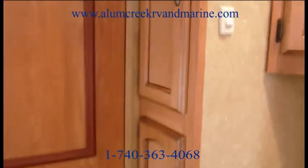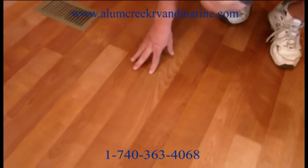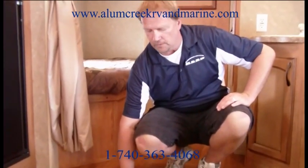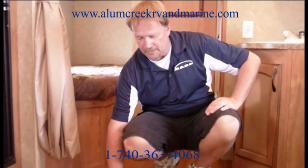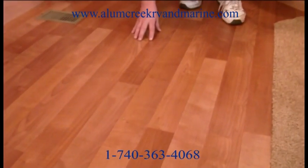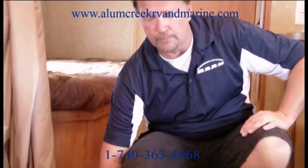What you can't see under this nice wood floor is that this flooring is 40% stronger than the average trailer floor. This floor comes from Weyerhaeuser and it is a 5/8-inch thick floor — not the half-inch or 3/8-inch that most traditional trailers use. Weyerhaeuser puts a 25-year warranty on the subfloor. It is impregnated with wax and water sealer — the same type that a lot of boat companies use for their pontoon boats.